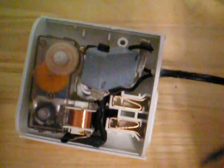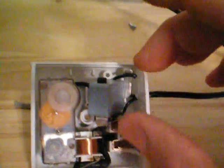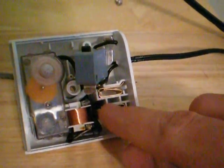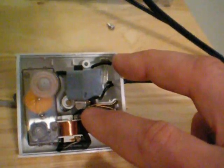I have already tested this — I just took it back apart to finish this DIY video. I sealed this a little bit just to give the wire some retention. Let's put it back together now and turn it on. To summarize: I soldered, heat-shrinked, and siliconed the low-voltage wire up through here, this low-voltage wire to this switch. The wire that was coming off of here is completely removed because it came from the prong. I took the wire from the positive plug straight to the prong, and then wired the two low-voltage wires to the contacts on the switch.